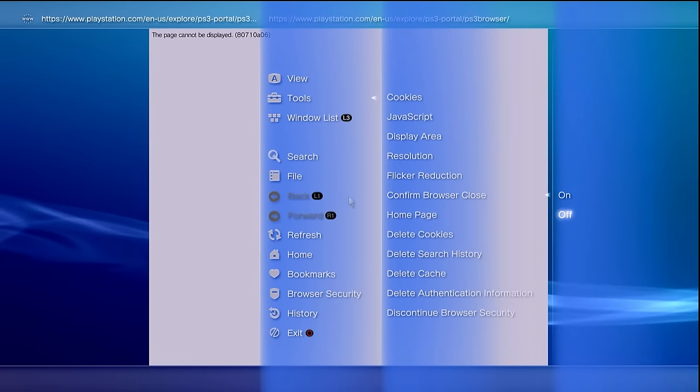Back at the computer, make use of the Pi PS3 Checker standalone package. Right click it, use 7-Zip to extract it into its own folder. Once extracted, double click the folder. You're going to need to bring your flash dump over from your console. Go to your USB drive and there should be a dump.bin file. Right click, copy it out, take it to the Pi PS3 Checker standalone package folder and paste it in. Then drag and drop it onto the drag-and-drop-your-dump-here bat file. A command prompt window will come up and go through the checks.